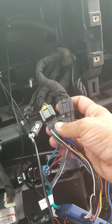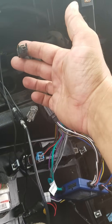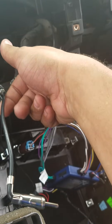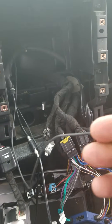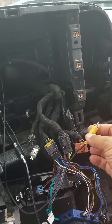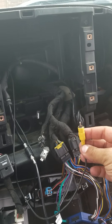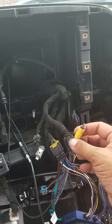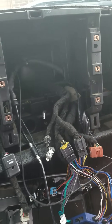Here are the two cables for the back of the stereo, the USB port that goes into the back of the factory stereo, and your antenna cable. I've tried to separate everything out — it's kind of a mess right now. This is just an old RCA video jack that I clipped the end off of, going into the back of my aftermarket stereo. I had to hardwire this in to get the camera feed.